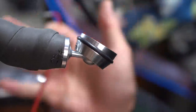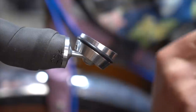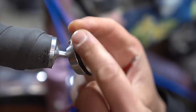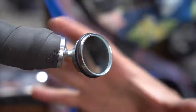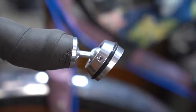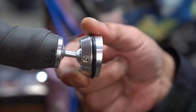Let's talk about this guy — the most expensive cycling mirror in the world again. This is the Gilles Berthoud handlebar mirror. This is how I had it set up while riding — it gave me a good view of cars behind me. The thing is actually really beautiful: nicely machined aluminum. You can reposition it with your hand; this rubber gasket makes it really easy to hold because it has some resistance. What's really cool is you saw the bumpy road — this mirror did not budge whatsoever. I've tried cheaper plastic mirrors with a similar style and usually they're really jittery and the image is almost unusable, nauseating. This is rock solid. On this side there's a grub screw, and I think this is what's used to tension the mirror on the ball head — this is what allows it to articulate. You can totally tighten this down to adjust the friction to your liking.